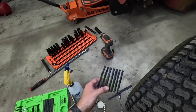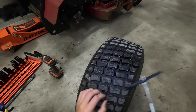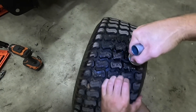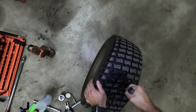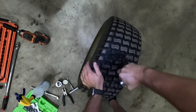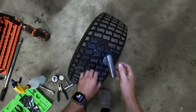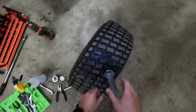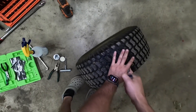You're going to feed that right through this tool here. We're going to take this and kind of spin it in, get it so the plug's in the tire. Sometimes you have to push on it a little bit and use a little bit of weight behind it. So I'm going to push down here and pull this out — and boom, your plug's in.